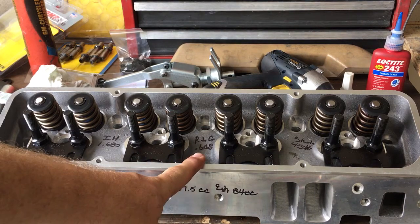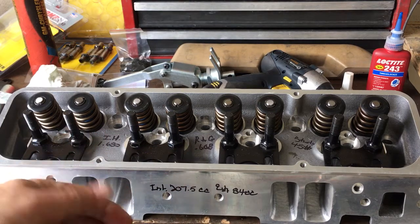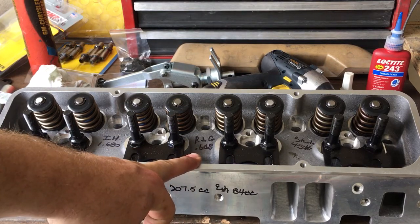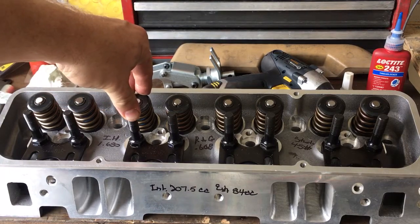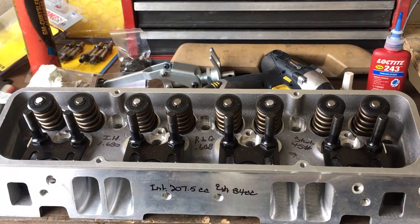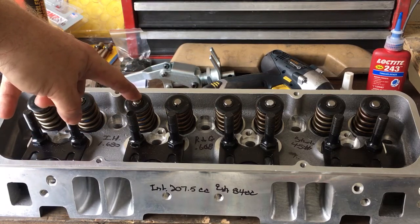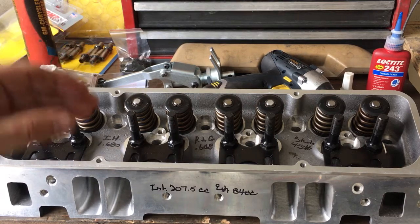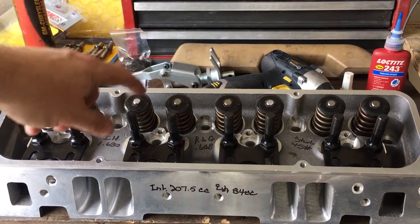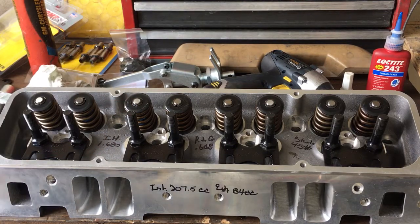Just to retouch on this retainer-to-guide: his cam is mid-to-high 460 lift. Let's say the high side of his 262 cam is a 469 lift. Comp Cams actually sells a Magnum roller tip rocker arm that's a 1.52 ratio. Some people may not even consider that as something to factor into their measurements — I catch everything and put everything into my calculations. That 469 cam becomes a 474 to 475 lift cam just by changing the rocker ratio from 1.50 to 1.52.